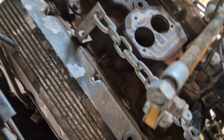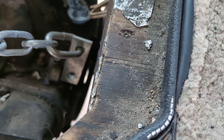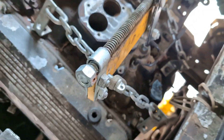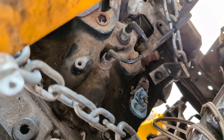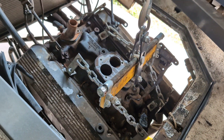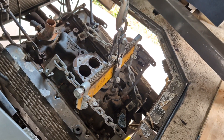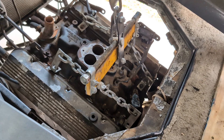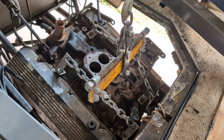Updates: had to take the throttle bracket off — 9/16ths, not a big deal. We've got the transmission backed out further and as you can now see, the flex plate is clearly visible, so the engine is entirely separate from the transmission. I've got the engine leveler hooked up and found some spots on the intake where I've put hooks — either nuts or entire bolts, got them in nice and tight. Aiming for pitch control, forward-backward control. Chains are under tension. Going down below to get everything kitted up and pull the motor mount bolts — once those bolts are out, the crane will be supporting the engine and we'll start carefully lifting.